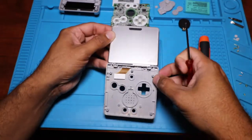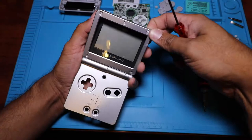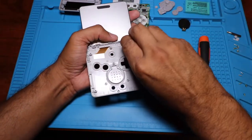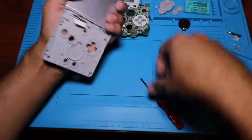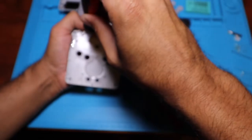There is one more little screw right there that's for the little cover for the hinge, so you're going to want to remove that as well. Again, if you're replacing the shell, go ahead and save your screws just in case any are missing from your new shell kit — but normally I think they ship out all the screws you need. Just try to remove the old shell. What you're going to want to do is feed the ribbon cable through that little opening right there. There's another screw right there to remove as well — be very careful when you run the cable through so that way you don't tear the ribbon cable.